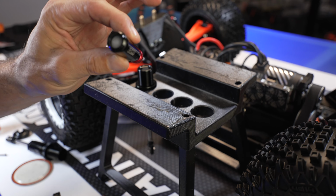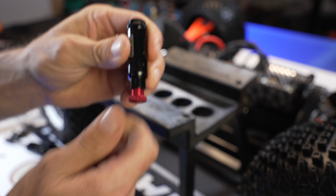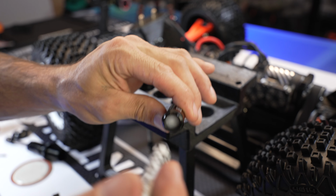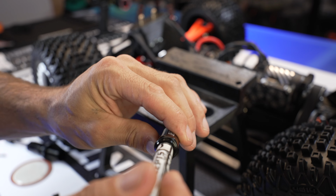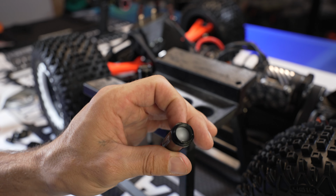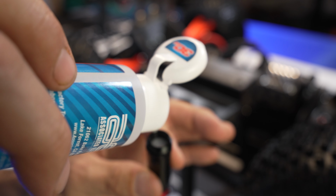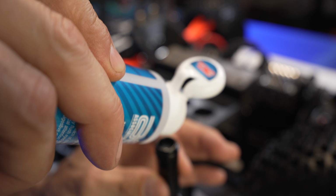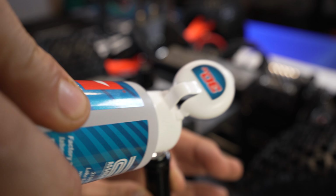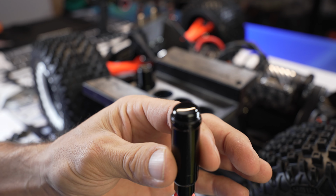You got this all taken apart and cleaned out. You can go ahead and start your setting. I'm just gonna start mine right at the bottom. And then make sure your piston has just been compressed. And then go ahead and add a little bit of whatever weight shock oil. I'm gonna use 30. So we'll just add 30 weight. Fill that up to the top, and you should let that rest so all the air bubbles come out. There's not much room in there for air.